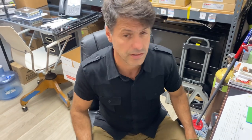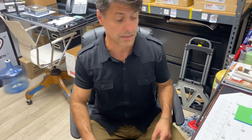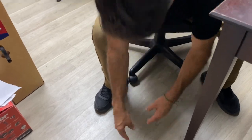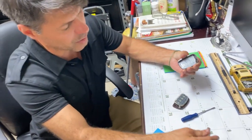Before you open it, I recommend touching your hands to the ground to ground yourself. Once you do that, you're safe — because any friction with your feet can create static, and that can burn the electronic parts inside the key fob. Just touch it with your bare hands to ground it, and now you're safe.